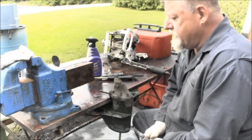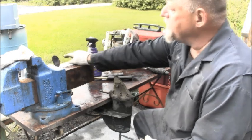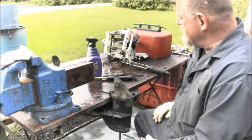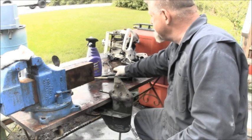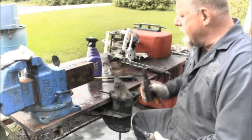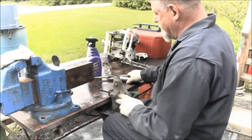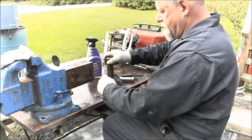If you've got one of these older motors, like a 6 horse or 7.5, and I think this one over here is a 9 1/2, the old turtle pumpkin motor, but I don't really know. I know this one's a 6. If it's been running salt water for any time at all, you're gonna need these impact drivers. If you have a work table, put it on there like that, and scoop right up against it, take my knees, so it's on there good. You want a nice squared off bit that fits well, because if not, you're just gonna strip it.